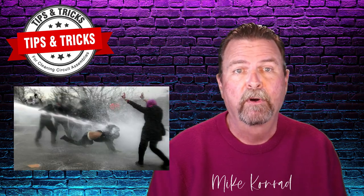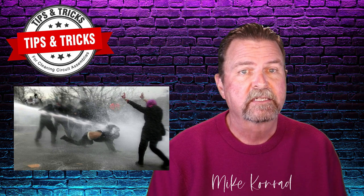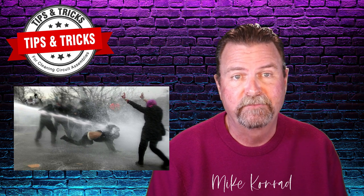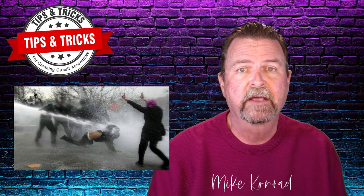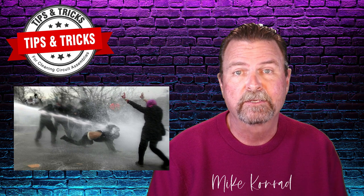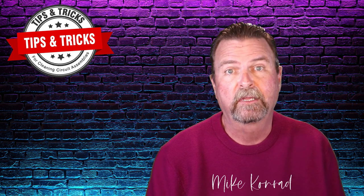Perhaps the best example to make my point is a water cannon. A water cannon uses a coherent jet of high-pressure water. When that water contacts an individual, it knocks them off their feet, as you can see here in the photograph. Notice, however, the two individuals standing next to the downed protester — water is bouncing off the protester and onto the surrounding people. Because the majority of the energy is lost once the water contacts the target and bounces off, the residual water flow does not contain enough energy to do anything but get the surrounding people wet. The same phenomenon can occur in a cleaning machine using coherent or non-diffused spray patterns, like a dishwasher or a labware washer.